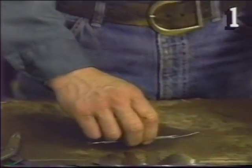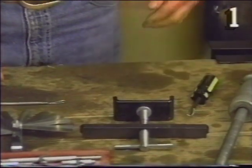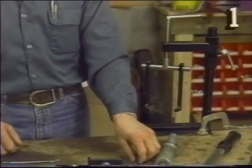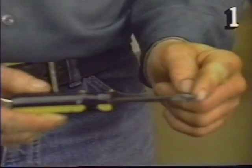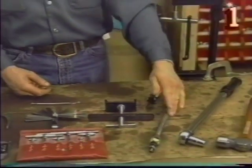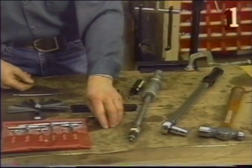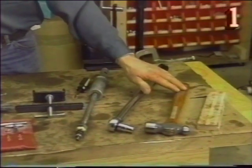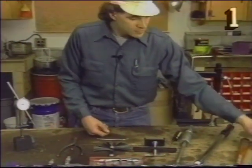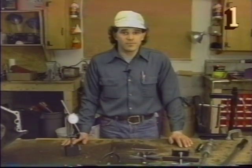of lip seals, an internal spring compressor for removing the in-case clutch assemblies, an external compressor for working on your drum type clutch assemblies, a modified screwdriver formed into a small hook for removing internal case snap rings, a slide hammer with a threaded end on it, which will match the threads in the front pump assembly for removal of it from the main case, a torque wrench, a medium-sized hammer, and most important, a small block of hardwood. These, along with common tools of different dimensions of wrenches, sockets, screwdrivers, is really all that's basically required to overhaul your transmission.